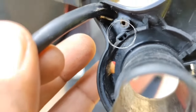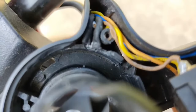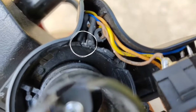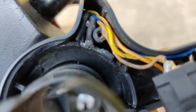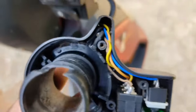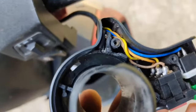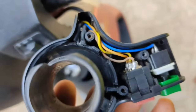Another important thing is the positioning of the Hall sensor. There is a specific place where you have to insert the Hall sensor properly. In my case, it was just a loose connection, and because of that the scooter was not running. So I removed everything and placed it back properly so that it fits well and works fine. I've now fitted it properly.